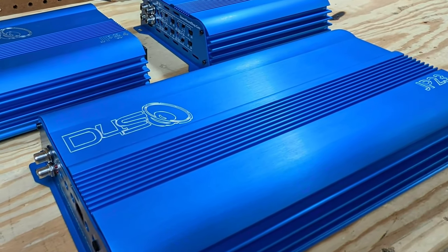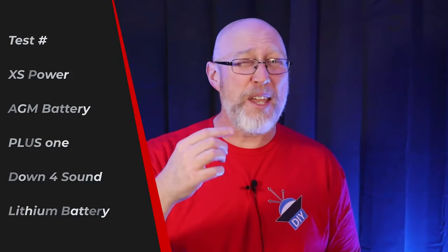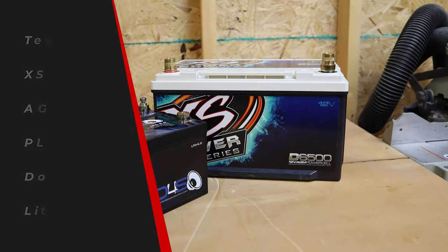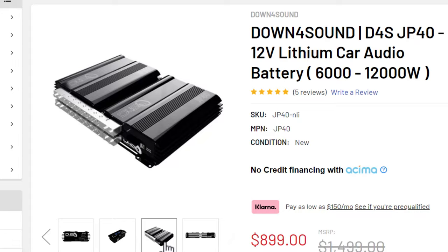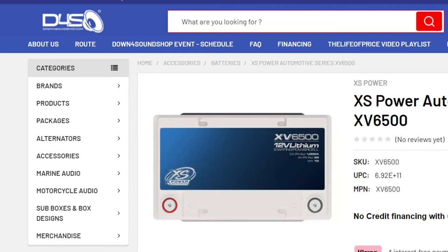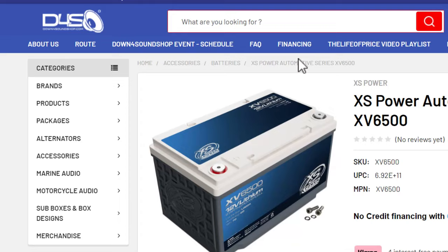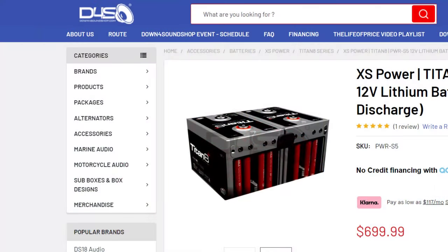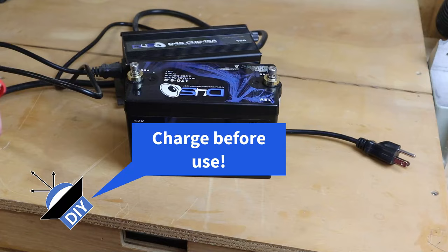What about lithium batteries — will a lithium battery help? Lithium adds complications. Most lithium batteries are not designed for use under the hood of a car — they can't handle the heat, and most are not compatible with your standard under-hood battery because they have different resting voltages, meaning your lead acid battery will deplete your lithium battery when the car is off. You can get insulated lithium batteries designed for under-hood use, or delete the under-hood battery entirely. Another option is lithium titanate batteries, which have a lower resting voltage and are a closer match to lead acid, making them compatible with a stock charging system.